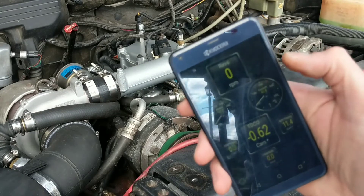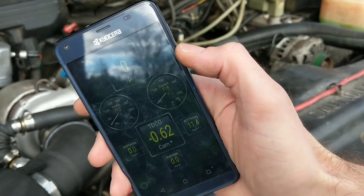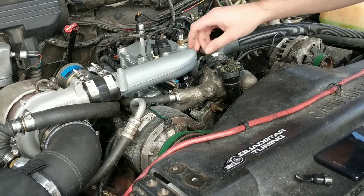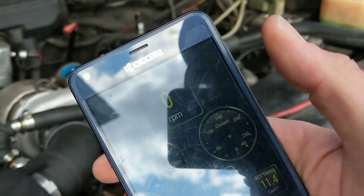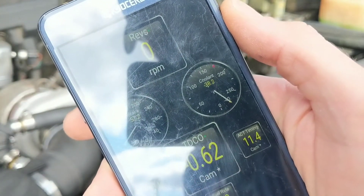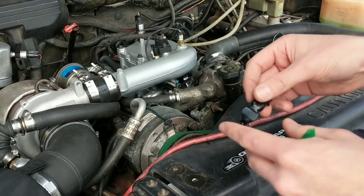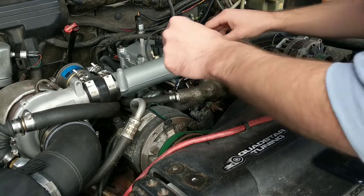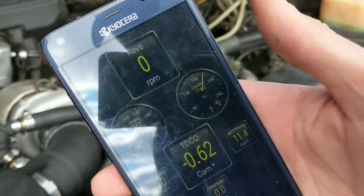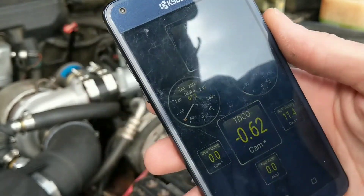Right now using the app we have posted on our website, the truck is at 51.8 degrees — it hasn't been run at all today. If we unplug the coolant temp sensor that doesn't work, because it puts the reading down to about minus 38.2 degrees. So what we're going to do is take our temp fooler, plug it in, and magically we have fooled the computer into thinking it's approximately 173 to 175 degrees — reading 176 right now.